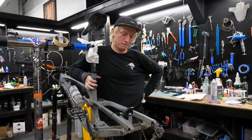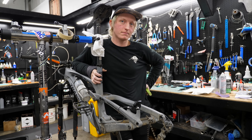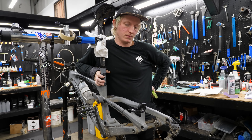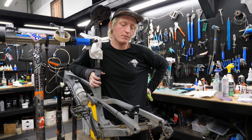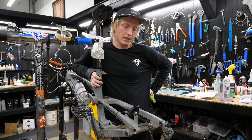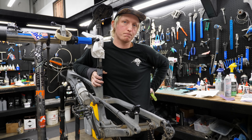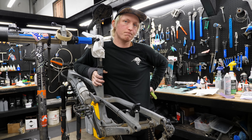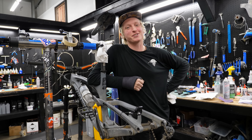So my last question here for the internet — because the Code RSC, even though we love them and most of us use them on our bikes, the internet does not seem to love them quite as much as we do. Is this something that you recommend doing on other types of brakes or is this just the Code RSC? This is every brake for sure. Regardless of its adjustments or features. You've got to open the system to some extent, and cleaning the pistons is the number one thing to do for sure. Cleaning the pistons, exercising the pistons, and opening up the master cylinder on the brake lever is a must on any brand of brake. So if this Patrol had Hayes Dominions or Maguras or Hopes, you would do the same thing — same principles, but slightly different procedures because they're different designs of brakes.